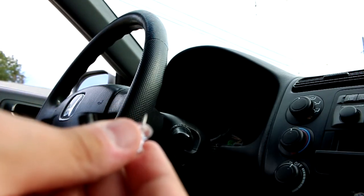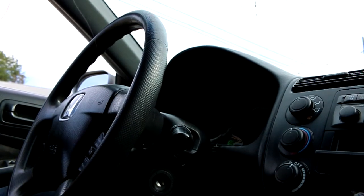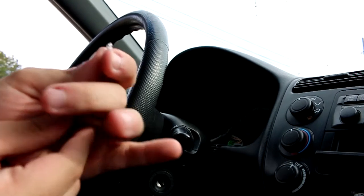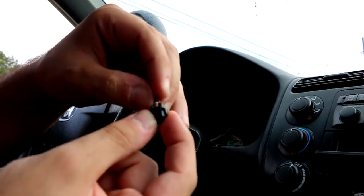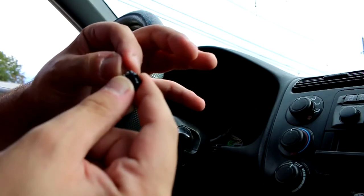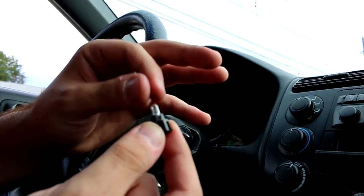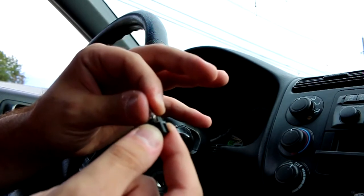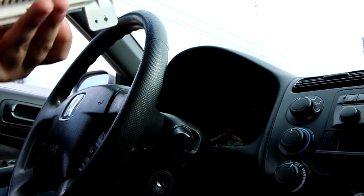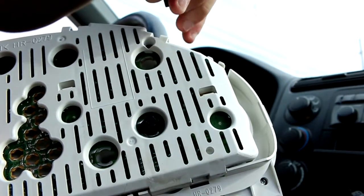You want to make sure you put the old light bulbs to the side and grab the new ones. These are supposed to clip in like this — you just snap them in. They don't really come out unless you really force it. That's all you've got to do: snap them in. That's also why the other ones wouldn't fit — not only were they a little bigger, but the base on the bottom wouldn't clip into the socket.